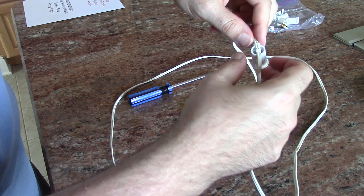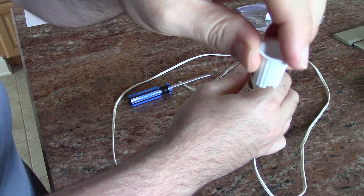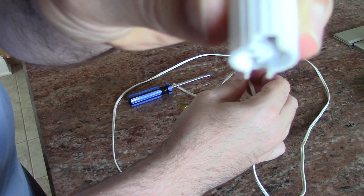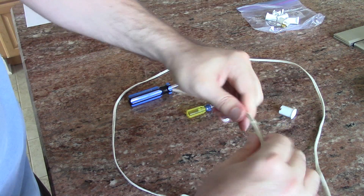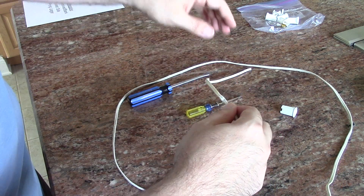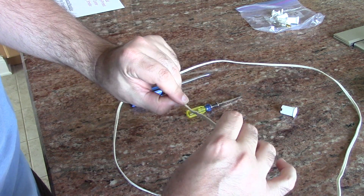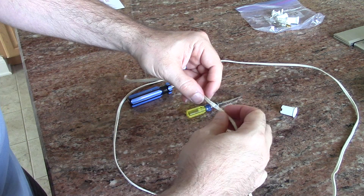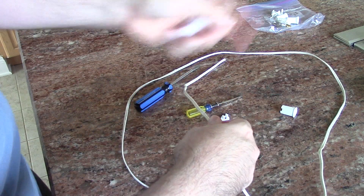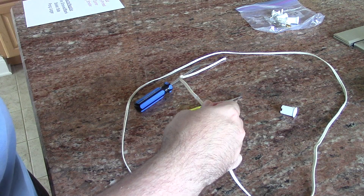The insulation down there looks okay. Now let's take it off the wire. These prongs are still very much okay — nice and sharp. Here are the two marks where the socket made contact. Now, what I want to see is whether the new one will line up properly. Taking from what Dynatrack said before — the wire facing the stove is the negative or neutral, and you can see the printing on the other one — so the neutral is away from me. Whichever makes contact with the side terminal should go on that wire.